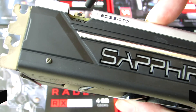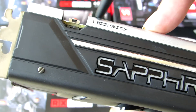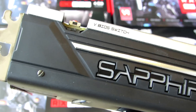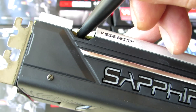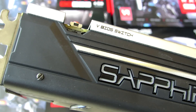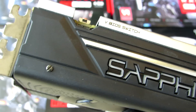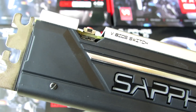You should test this out yourself and confirm that it is stable and working. Before you start, make sure that your vBIOS switch is to the side of the HDMI and DisplayPort outputs. You want the vBIOS switch on the silent side when you flash your card. Make sure you back up your silent BIOS before you flash your card.